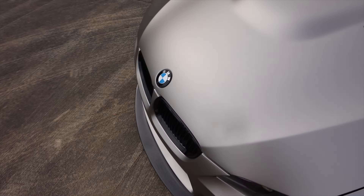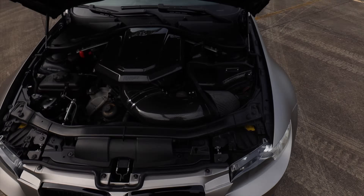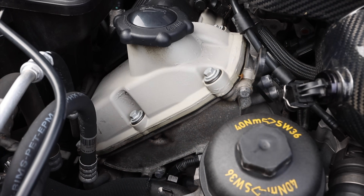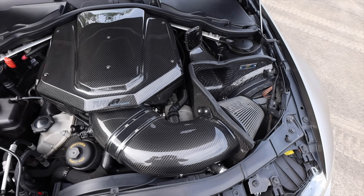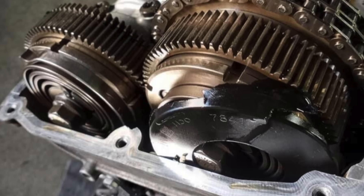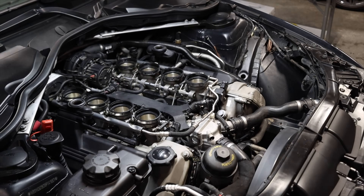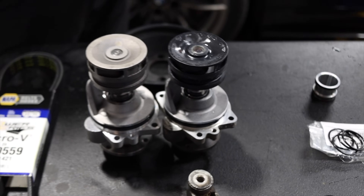Another thing you could talk about are valve covers. A lot of times with these cars you'll find leaky valve covers — it's super common with the E92 M3s. I'm going to assume mine were replaced before I bought this car because these valve covers look really, really good. Another pretty common issue you hear about are the VANOS caps cracking; they are made of plastic so they can fail, though I haven't had that issue. We also replaced the water pump and thermostat — the factory one is made of plastic, and I went with an upgraded metal one that will be more durable and last longer.